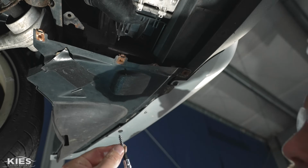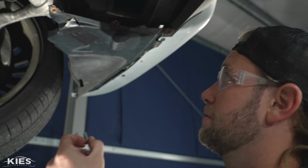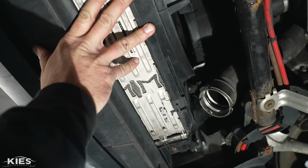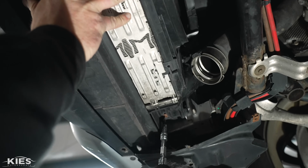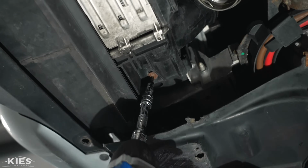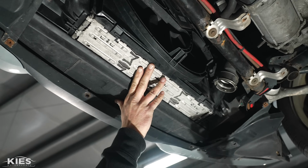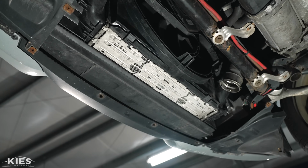And with your ProTuningFreaks intercooler, it's actually going to include new ones that are a little bit longer. So this will not be reused. Now what you want to do, just so it doesn't fall on your face, it normally won't, but always be cautious. You want to support the intercooler and then remove your other T25. Okay. So as you can see, it didn't fall on my face.